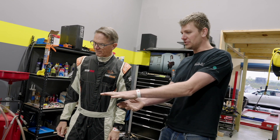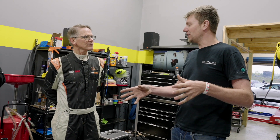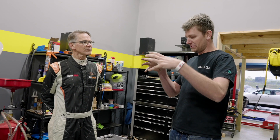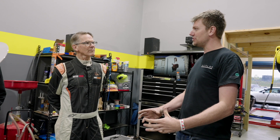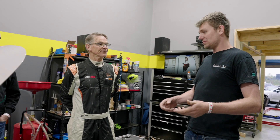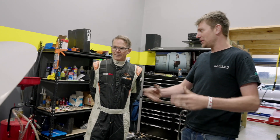The motor sits on top of the subframe. One of the key goals was to not mess with any of the geometry, suspension, or handling, since this car is known for being a great road car. Everything sits on top of the subframe and drops down with the gearbox into it. The factory GR86 axles go right in. You can go to any GR86 or BRZ source and replace control arms, axles, hubs, and wheel bearings — it's all still GR86 BRZ parts.